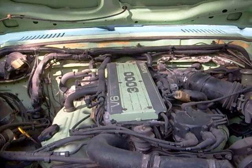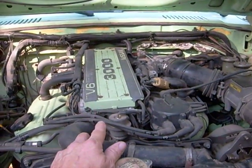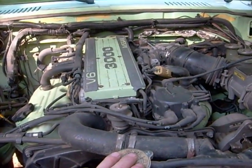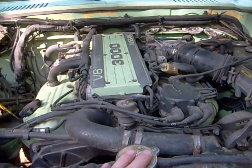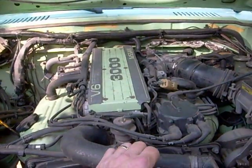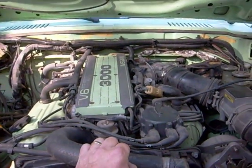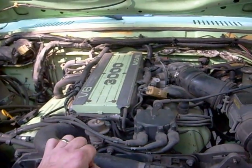The truck's been running great ever since — I've never had any trouble with it. These engines are carbon magnets behind the intake valves. Sometimes back east when it gets really cold, they'll start and stall a half dozen times before they get enough fuel into the port to start. Getting that carbon off the back of the intakes can be tiresome. I just keep a little Techron in the tank. The 3M injector cleaner we used at the dealership was basically Techron anyway. I've replaced four of the six injectors and I'm still running on two of the originals.